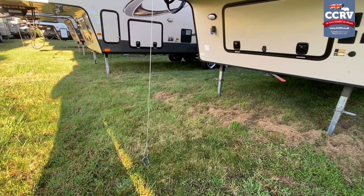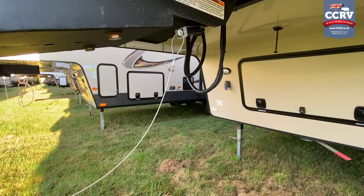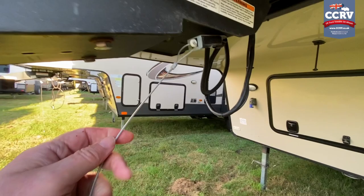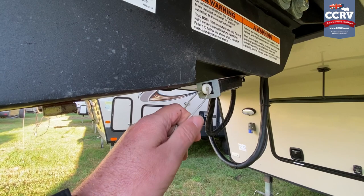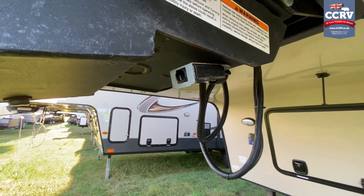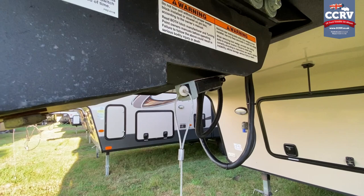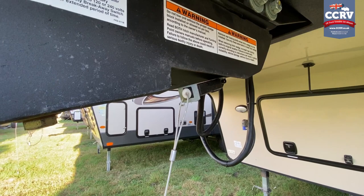We're down at the front of one of the Rockwoods here and I'll show you exactly how the breakaway cable works. This piece of metal cable here hooks up onto the back of the truck — either on the hitch or somewhere at the back — and that in turn is hooked to this bit of plastic here. If the fifth wheel falls off the back as an emergency, this literally pulls out. This electrical device, all wired in, will put the brakes on automatically because all of these fifth wheels have electric brakes. What happens is some people use this as a handbrake — it's not a handbrake, it's an emergency brake.